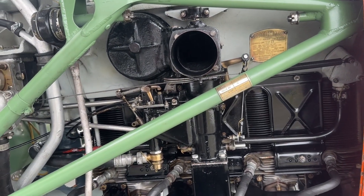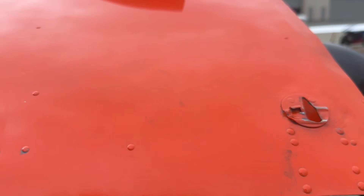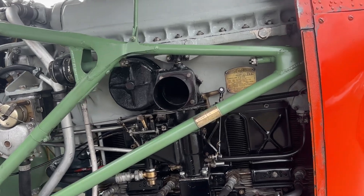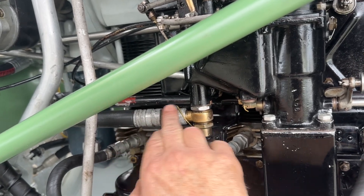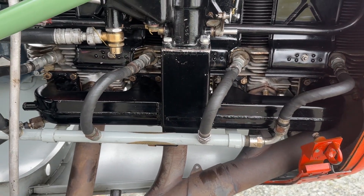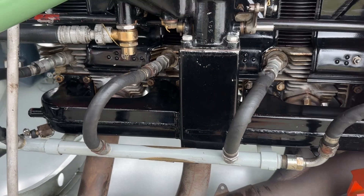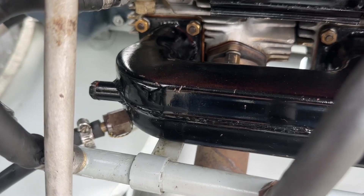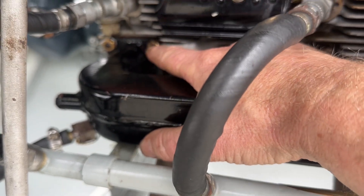This round circle facing you is the inlet for the carburetor. When the cowling is down, there's a lovely scoop up there which directs air straight into the carburetor. The carburetor takes a feed of fuel from the fuel pumps on the other side, mixes it with the air, and directs it into this box here — an upside-down T shape with a very broad horizontal member — which is the inlet manifold. That delivers a mixture of fuel and air to each of the four cylinders.